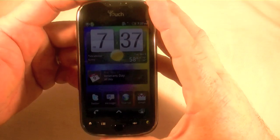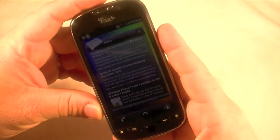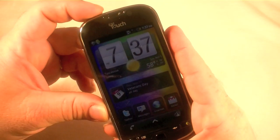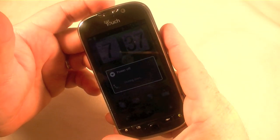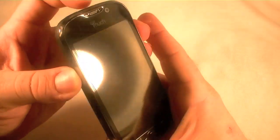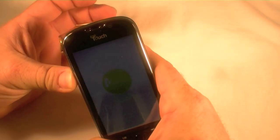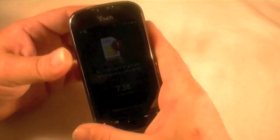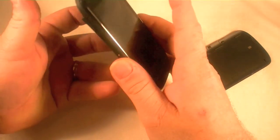What I'm going to do is show you how to do a hardware reset using the keys. Let's say you can't get into the actual device. So I'm going to completely power it down. I might have to remove the battery but I'm not sure. I've done this once before — you just hold down the volume down and hit the power button, and continue to hold the volume down. That did not work so I'm going to power it down again and remove the battery just for a moment.